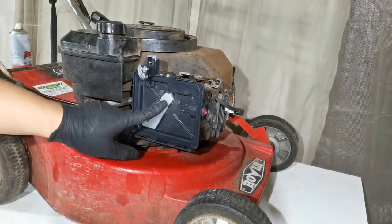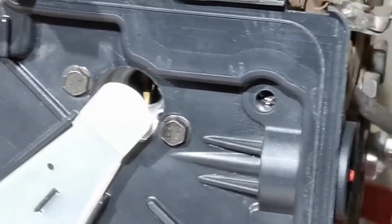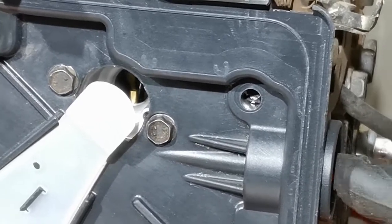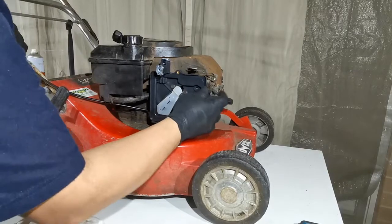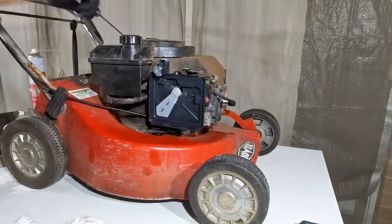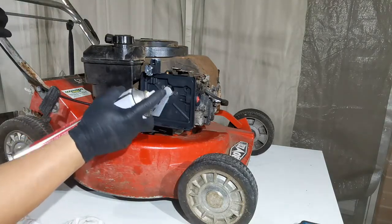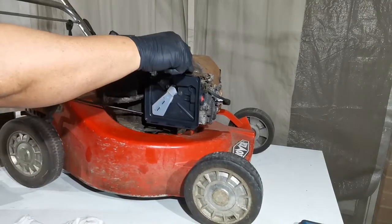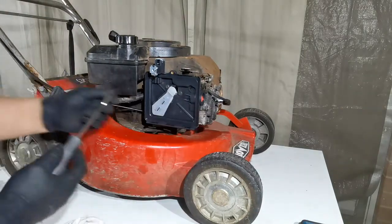I'll show you — let's look closely at the jet when I prime. So there's nothing coming out. It's guaranteed that this one won't work. Let's try to prime and start the engine anyway — that won't work either, so just spray to get it running. That's the problem with a different type of primer base assembly.